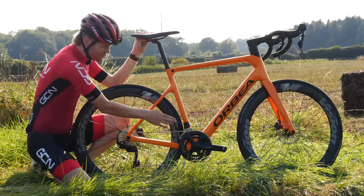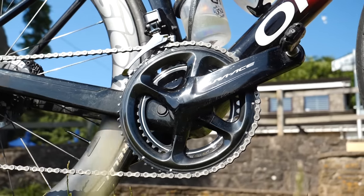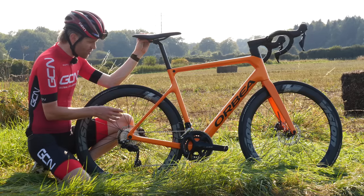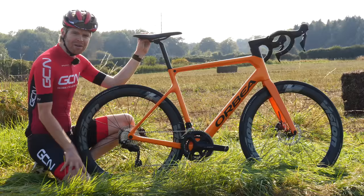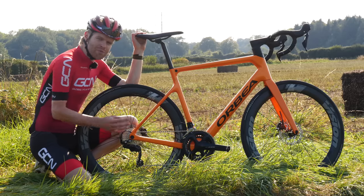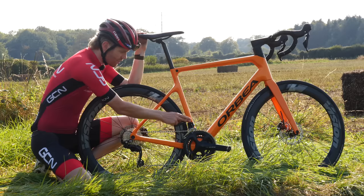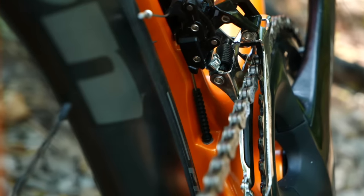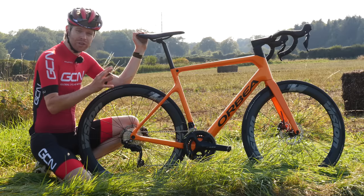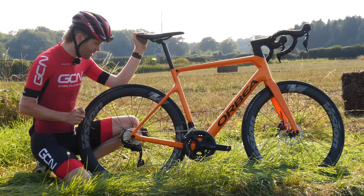Now, it's the same design as what's found on the current Dura-Ace, and outwardly it's a lot more complicated than the front mech that we've got on the 7900. But this design has a number of key advantages. This front mech design is better able to manage the front cable and dictate the angle at which it comes in to the front derailleur. On previous designs, this could be influenced by the frame you had, and then that could actually alter the shifting performance of that front derailleur, because on different frames, the cable comes out at different angles.